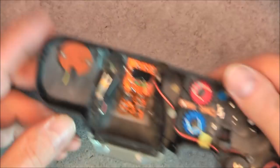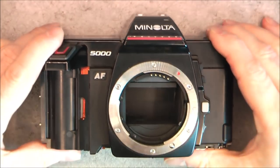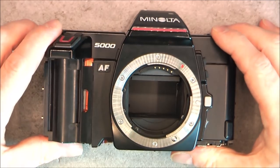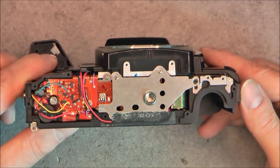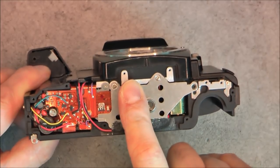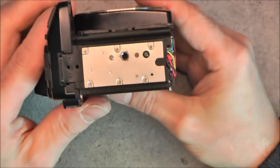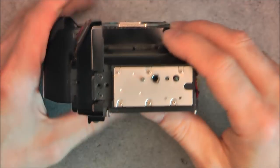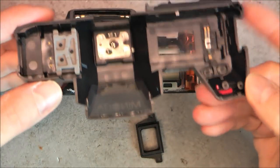Next one — the Minolta 5000. It is a consumer camera, a variation of the more expensive Minolta 7000 with a few fewer features. The bottom plate is already missing. You can see the same kind of construction: a metal plate securing the back and front together, flat flex, and what seems to be a DC-to-DC converter on a rigid board, with contacts to the batteries that were in the grip. If I remove the top there is not much in the top piece as you can see.